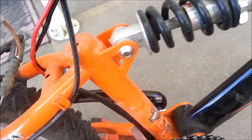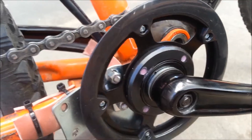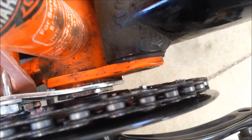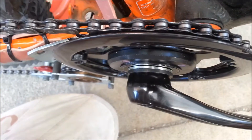I had to change the clamp — I used some standard U-clamps but they were too long, so I had to grind them almost all the way to the nut because it was hitting the sprocket. And I kind of bent the bottom bracket retainer a little bit because I stripped it, so it was hitting the freewheel sprocket.